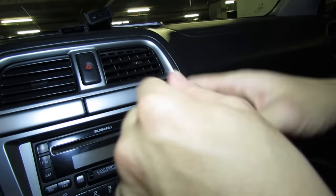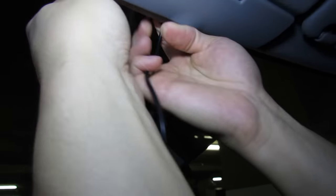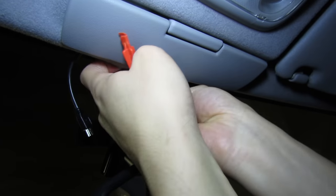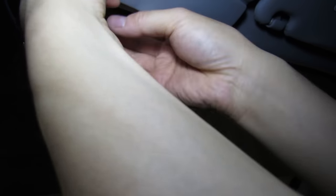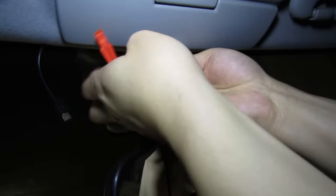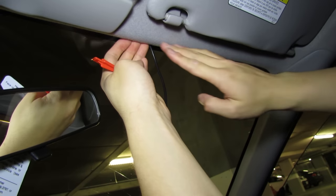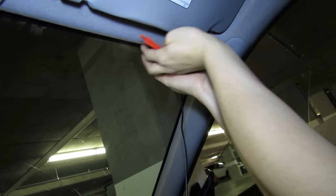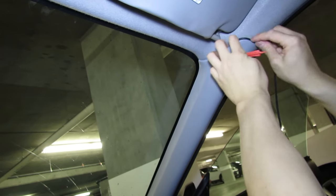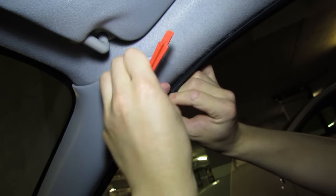For the power cable, all I do is start from the top and work my way around the molding. You can use a credit card or iPhone opening tools and just feed that underneath. You'll want some slack here because you don't want to run out of cable by accident. Once you think you have enough slack, you can start running it towards the A pillar — just run it along here, run it down the A pillar, get it underneath this trim, pull back on the rubber seal, and feed it underneath all the way down.